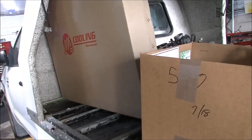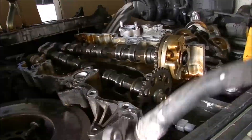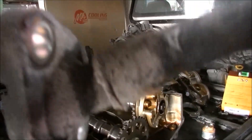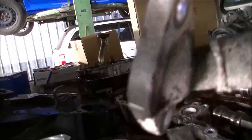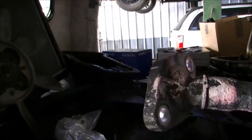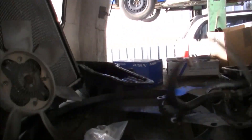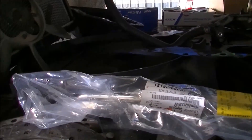I think I'll whack some rings on a piston and start putting it back together. Another thing we're changing - these are usually the cause of most overheating. As you can see, this one's starting to go around that little join there. It's hard plastic and that's where they snap. They break off the air and they cook. So we're replacing the genuine Toyota plastic one - we put a steel one in there, and that'll make it more better.